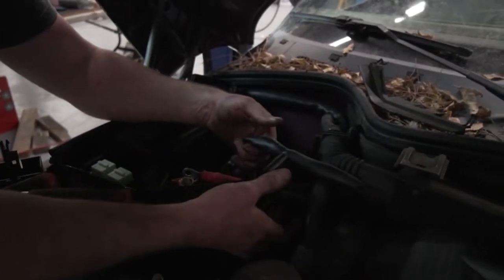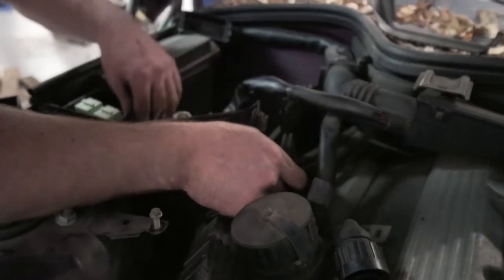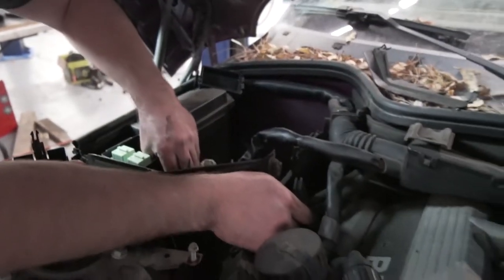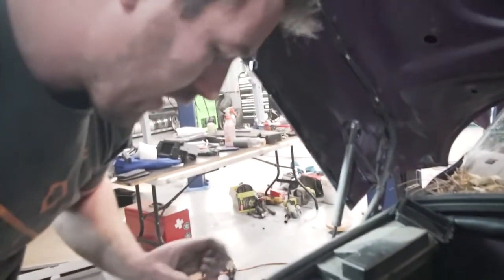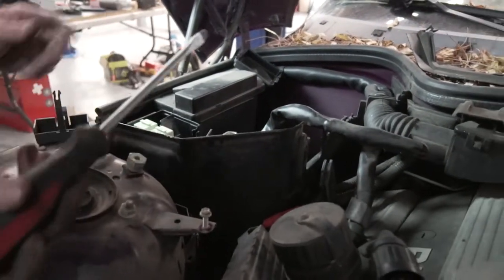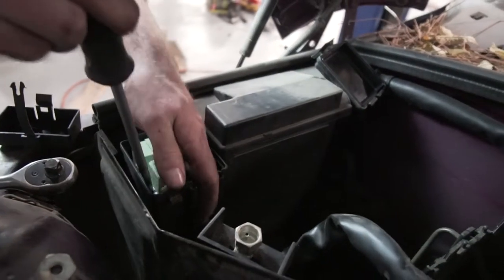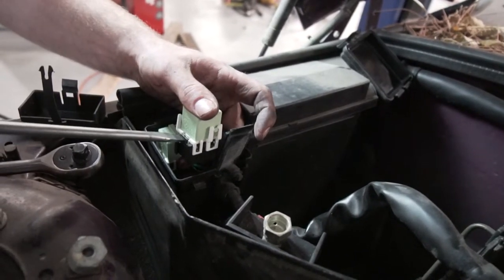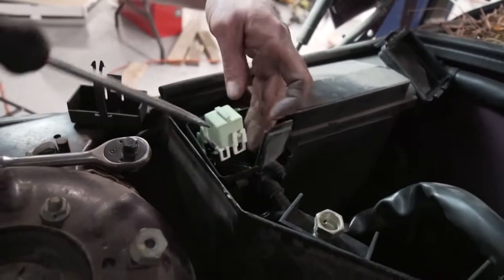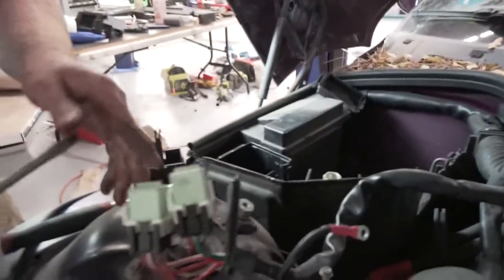You can see this rubber grommet comes up and out. This wiring is almost identical — I think this would actually even bolt into an E36. After you get those out, you want to come over here again with your standard screwdriver — exact same way we got that diagnostic plug out. It's hard to see, but this tab right here, you want to pry it towards the relay and pull up on the relay. You've got two of them, and then that whole plug is loose.